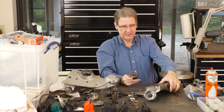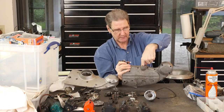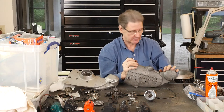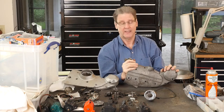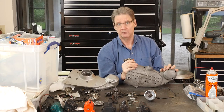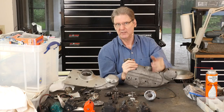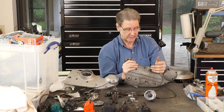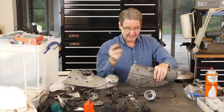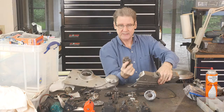One of the things with this earlier cover — a circuit breaker or magneto goes in from the top. I'm not even going to talk about magnetos. I had a magneto bike and kicked it 30 times and ran it for years. Then I gave up. Now that I converted it over to points, it starts on two kicks usually. When it's warm it starts on one kick. So magnetos — that's a whole other show. I gave my last magneto to Preacher.